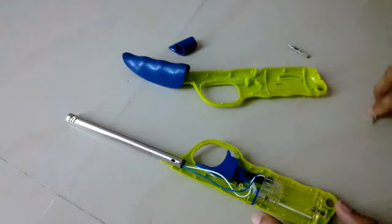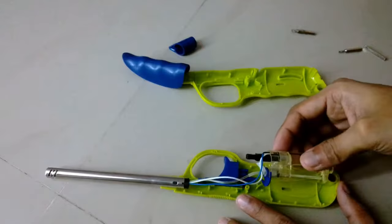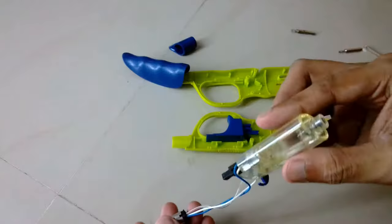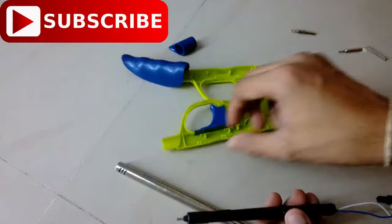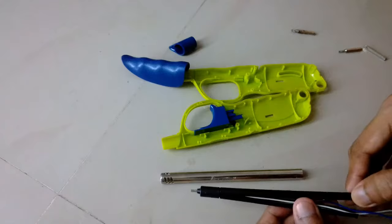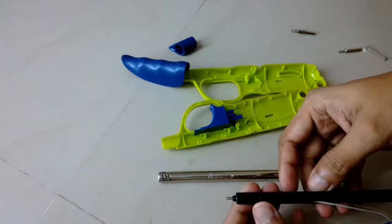This is the gas tank and the metal tube on top is where it lights up. You can see a couple of wires and a tube. The rubber tube takes the gas to the top part of the lighter. The blue wire is the ground and the white wire carries the spark — it sparks towards the ground, which is connected to the metal tube.